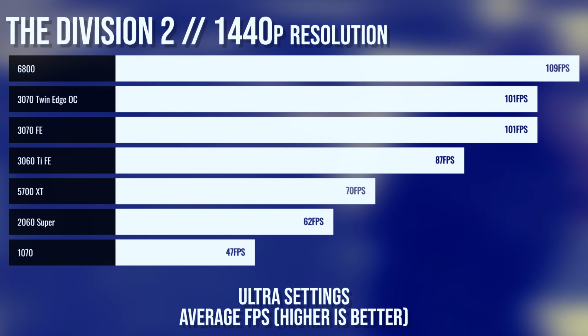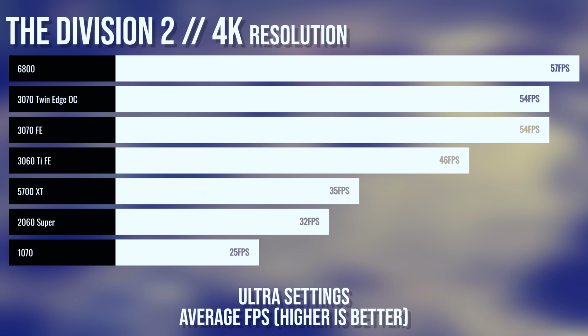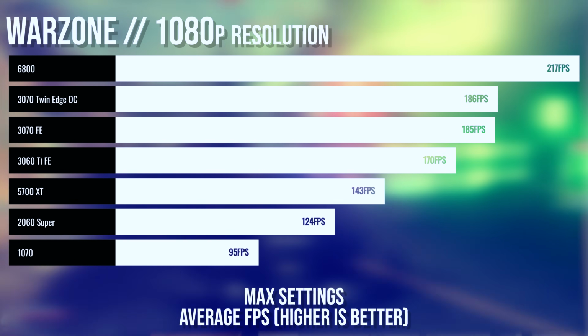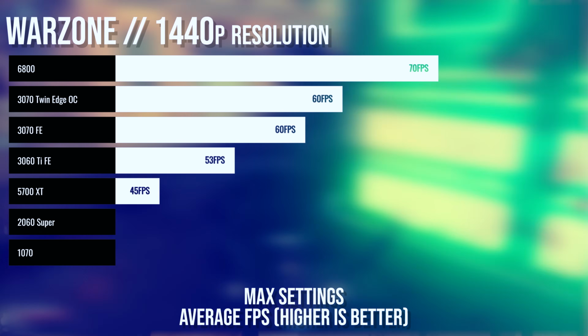So you're losing a couple of percent, but you're dropping down the power consumption considerably, and you're getting much better temperatures even on the auto fan profiles out of the box, going from 70 all the way down to like 60 in a 28C ambient environment.